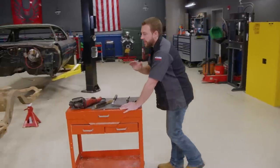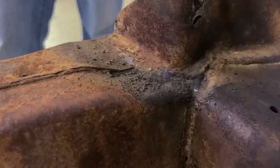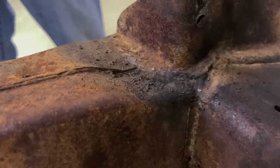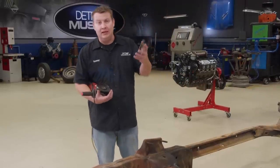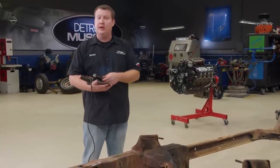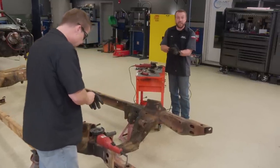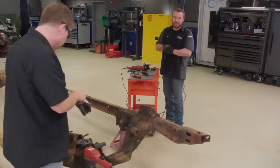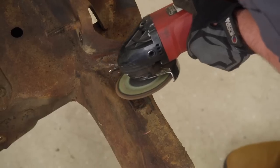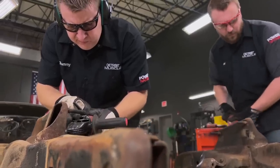What we plan on doing is sandblasting the entire thing and then powder coating it, but either method requires a little prep work. On the frame, it looks like the welder wasn't too worried about welding boogers, so we're going to clean it up. I like to use a blending disc instead of a grinding rock — a rock is really too aggressive, and the marks it makes on your frame will show through your top coat. All we're trying to do is smooth everything out and knock down the high spots. The more time spent, the better the end result.